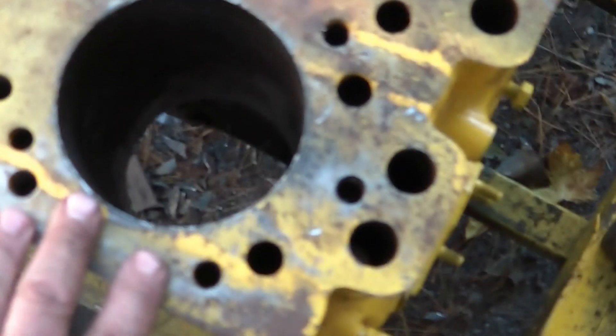There's the liner. The motor had been rebuilt approximately 50 to 60 hours before I got it. What had happened was the person who did the rebuild did not push the liners far enough down in, so the liners were actually sitting about a millimeter or two above the deck surface. That wasn't very conducive to sealing, so a lot of water was going through and into the piston area, and it actually fractured a couple of the rings.